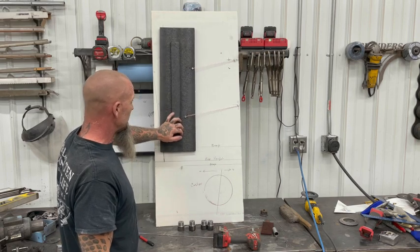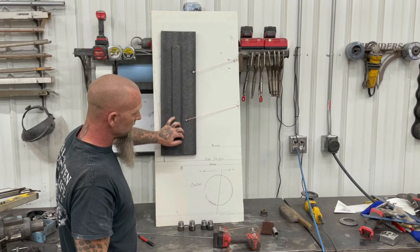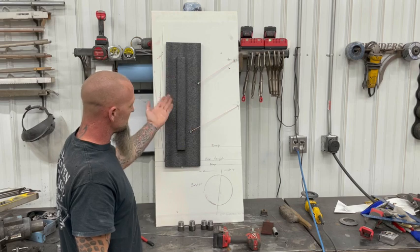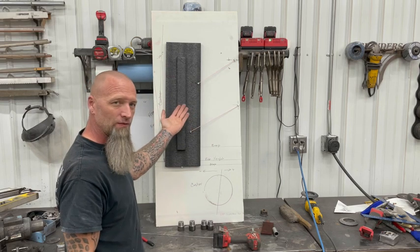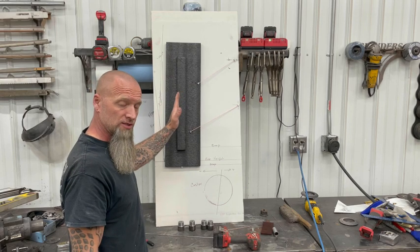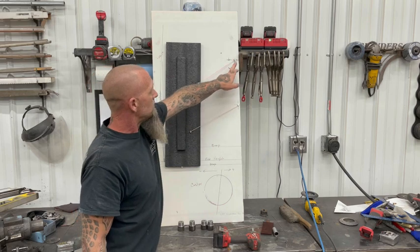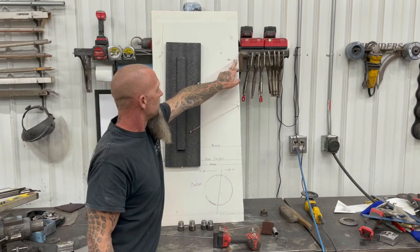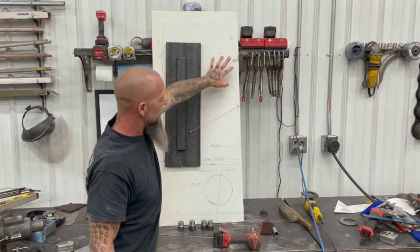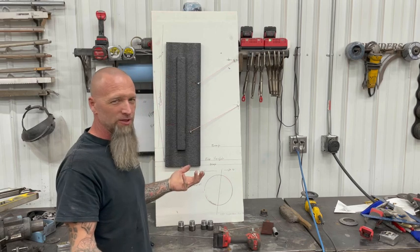This would actually be a pretty nice setup too. It doesn't matter how much the car dives. It doesn't matter where you are in your suspension cycle. You're going to maintain 100%. And this would be more of a full race type setup. You could set your camber wherever you want and it's going to stay there 100% of the time, which is going to make it more predictable. I can't use this mounting position. I have to be out here. I have to be within a 3 inch arc of that. Just build issues.